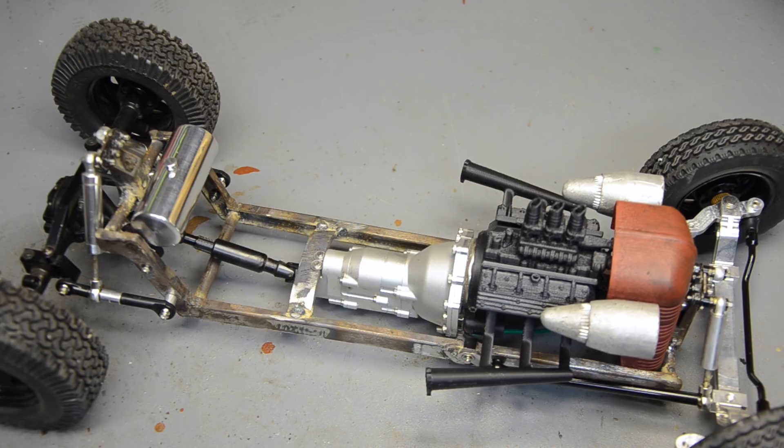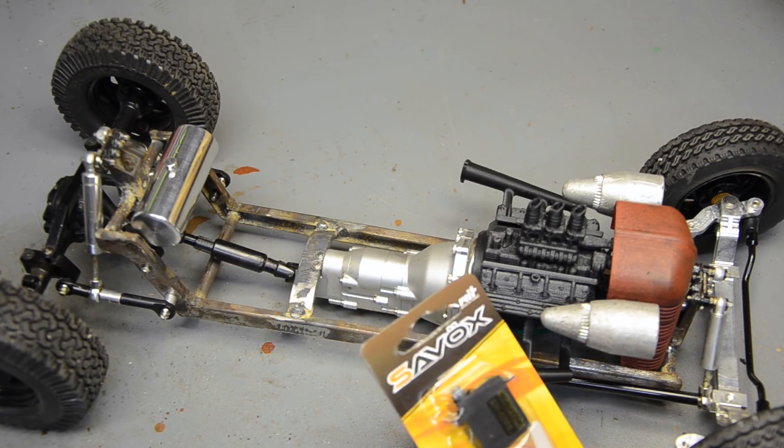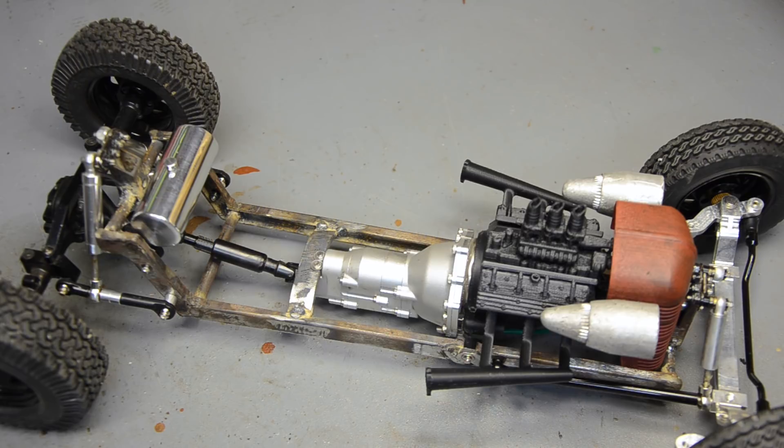Steering is probably going to be the next hurdle. I bought a micro servo — it's a Savox metal gear with 33 ounces of torque, which is pretty good for that size. The one I put on the number one build had like 15, so not amazing by crawler standards but enough to get the job done, especially right up front. I'm looking at putting it behind the grill — I've got a lot of room between the motor and the front of the grill.